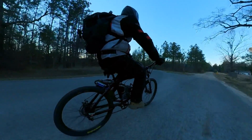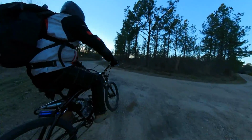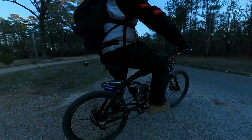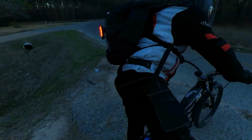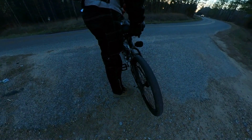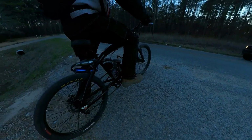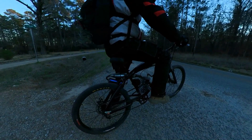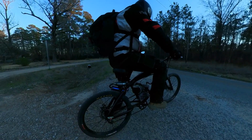Now on to the main issue that I'm having with this bike. As a matter of fact, the only issue that I'm currently having with this bike, which is not something I can often say. And it's still clutch adjustment related. Now the super clutch is performing flawlessly. There's 100% no slippage that I can find when I pin the throttle on this Minarelli. So we're good there as far as performance is concerned, but unfortunately I can't keep it adjusted to where it will fully disengage. After I adjust the clutch, ride the bike for a little bit, I find that it's always dragging and I can't get a nice idle because of this drag. The motor will stall or it'll just want to keep running the bike.